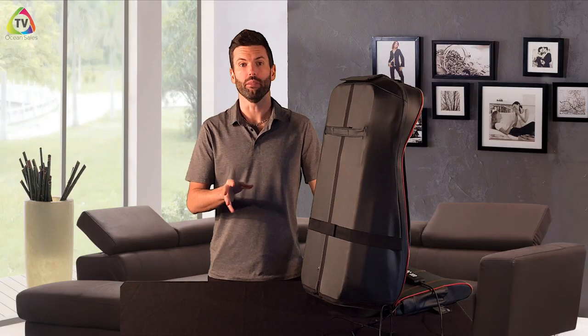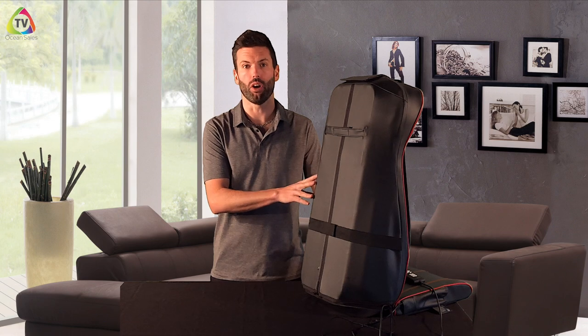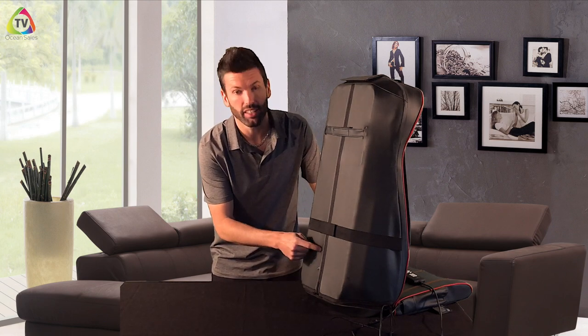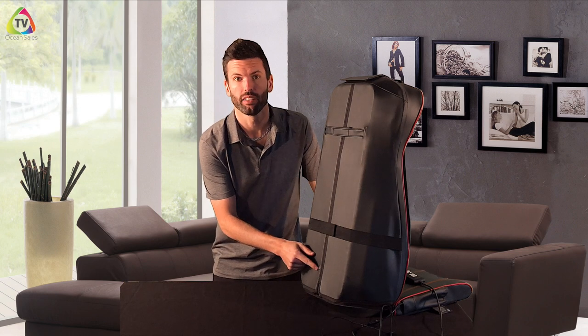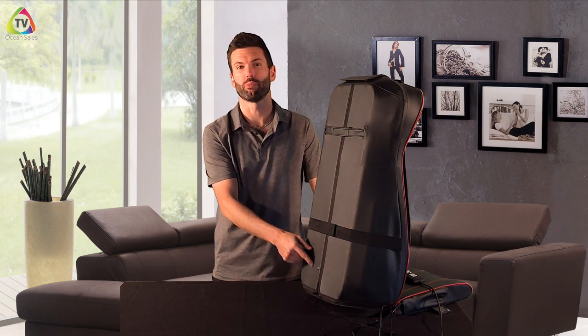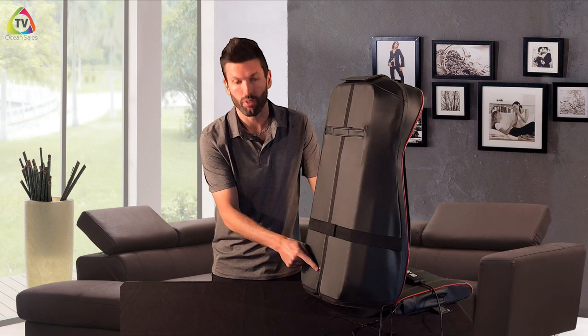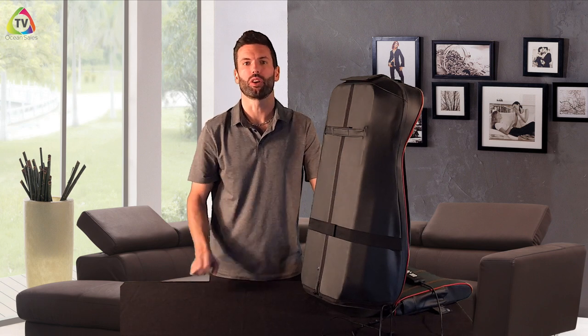Your first and most important tip: the first time you take the machine out of the box, you're going to notice on the back there's a little warning card with an allen key and a screw. This is a shipping screw to stop the machine from turning on during transport. All you need to do is take the allen key, remove the screw, and the machine is going to start working.